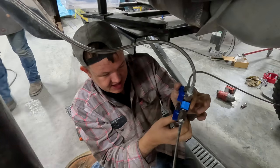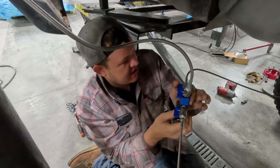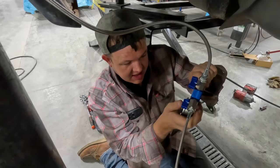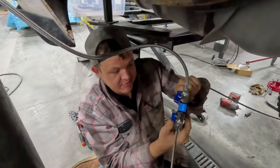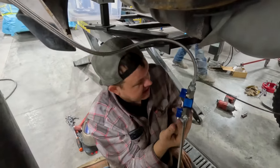We're gonna let all the air out of this strut, zero it out. We're gonna put fresh nitrogen in both coilovers. This is a little bit different than ORIs. So we're just gonna put 150 PSI of nitrogen in both. I think it takes 150. So we'll put 150 pounds on both sides.